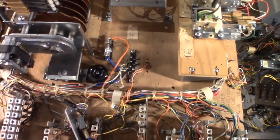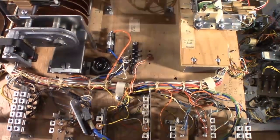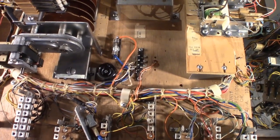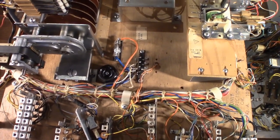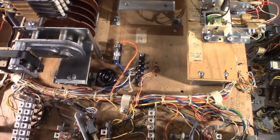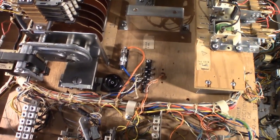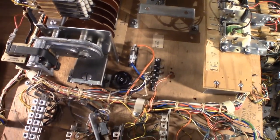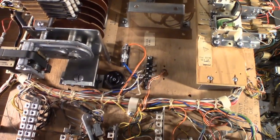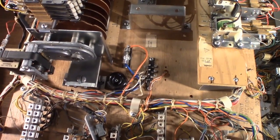This part here, we talked about it in the last video about replacing it with the new one. Unfortunately, I did not realize that those bottom plates on score motors came in different sizes, so that was new to me, as I never had to change one out before. So the one I received from a pinball buddy was actually shorter than the original one. So this is the original one. I just transferred over the screw here, and luckily I had the original retaining clip on there, because one was broken. So we're good to go there. Everything worked out fine.